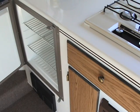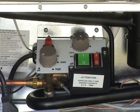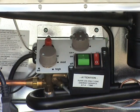If you have the 1.9 cubic foot refrigerator, you have three options for operation. The controls to operate the refrigerator are inside the vent cover on the outside of your camper. Your first option is 120 volt electricity, which you select by pushing the green switch on. This is your best option and should be used anytime you can connect your Scamp to a 120 volt power source.